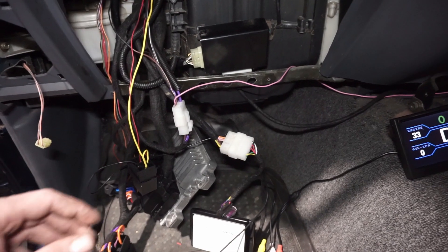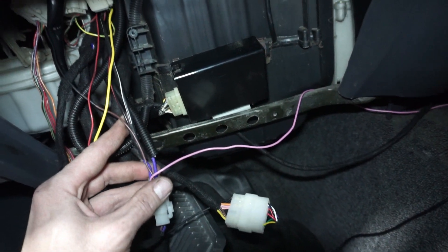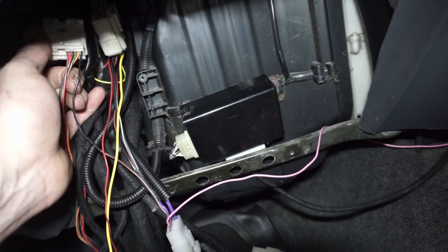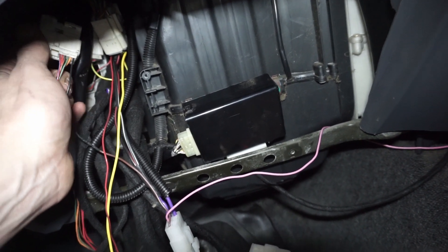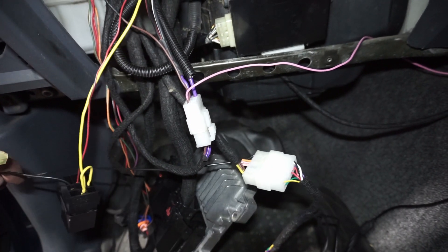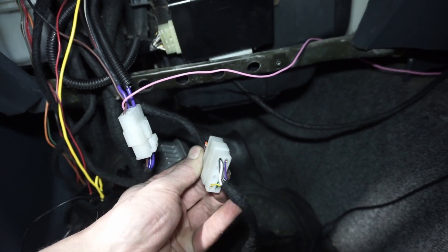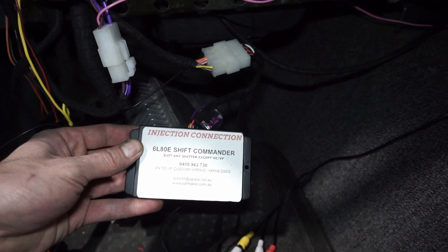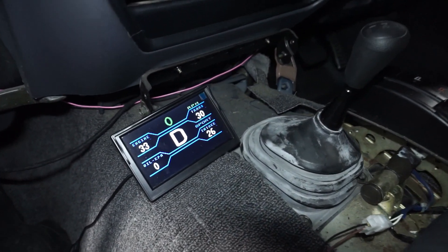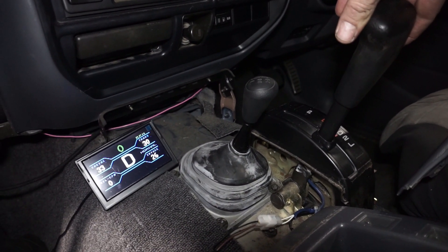At the back of the engine we've mounted the 1FZ oil pressure sender and run the wires up to here. Inside the car we've got a white plug fitted to Allen's harness — the pink is the ignition wire and the purple goes to the two starter trigger wires. The plug for the dash and reverse lights: the black wire in the corner is for the tacho. The red and black wire from this plug is for the reverse lights, wired into a relay powered by a yellow wire. The black wire is the earth trigger coming from the tap-up tap-down module — on the other side of the plug it'll be the purple wire in the corner.